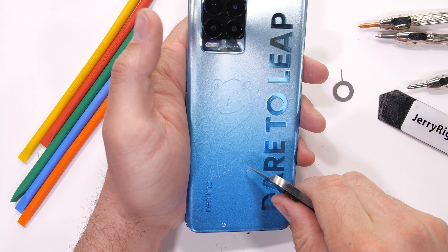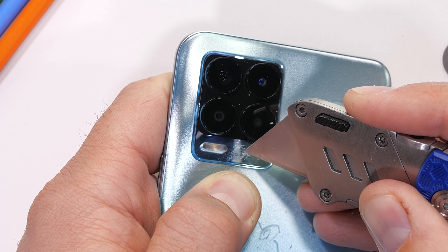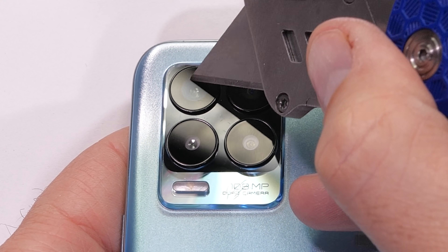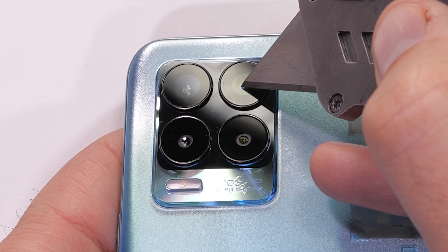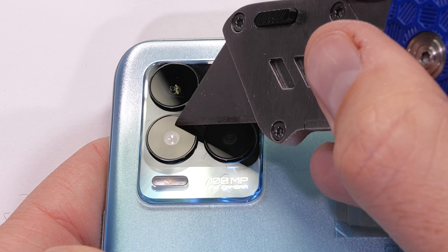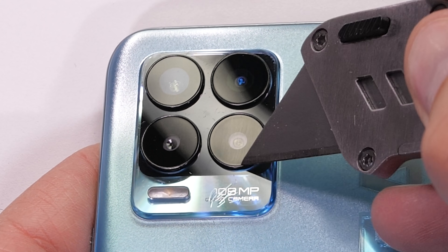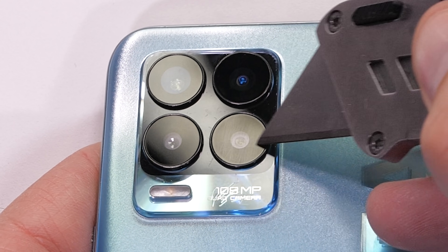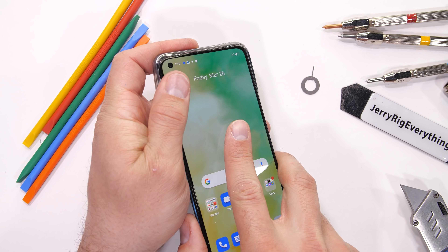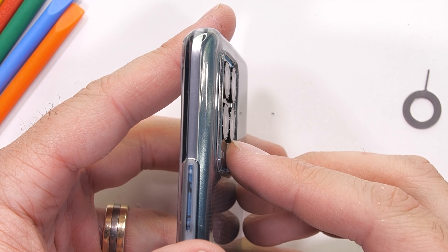While this is a budget phone, one of its most impressive attributes is the 108 megapixel sensor in the stove top looking camera setup. The square camera bump is made from plastic, but the circular surface covering the 108 megapixel Samsung built sensor is made of glass. This camera can shoot pictures that are 12,000 by 9,000 pixels — it's not the same sensor used in the S21 Ultra though, it's got a slightly smaller footprint. Then we have the 8 megapixel ultra wide camera, the 2 megapixel macro camera, and the 2 megapixel depth camera. Putting the clear case on the back, it looks like it sits flush with the camera lenses, so it's good that at least one part of this phone isn't made from plastic.